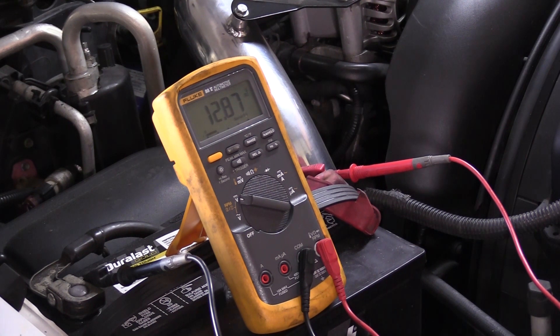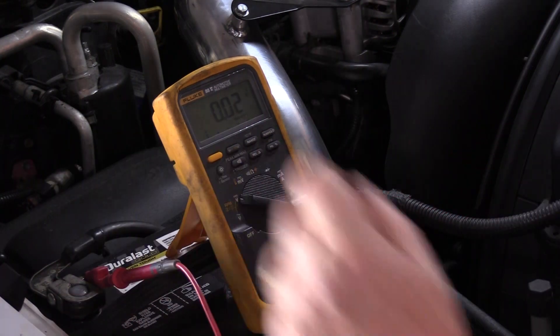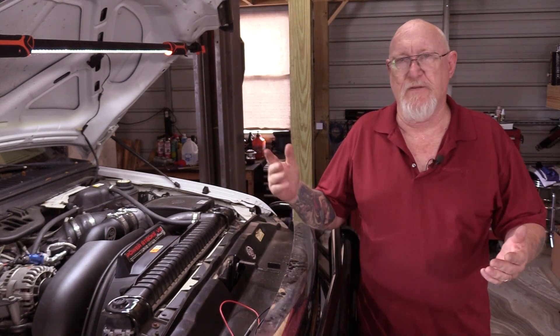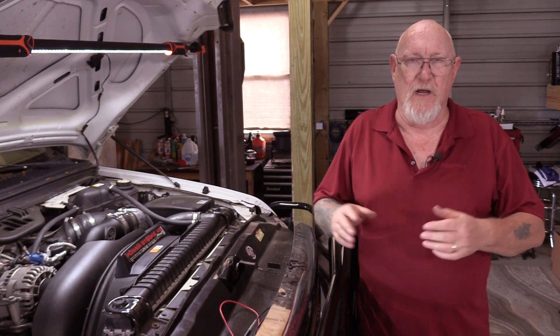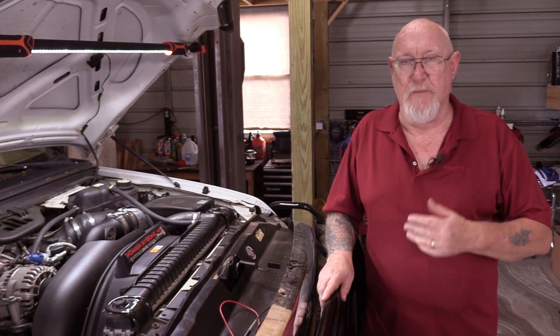When we talk about electrical theory, it's often referenced to the positively charged particle — a proton — even though we know it's the other way around. We can show that by reversing the leads: since we're measuring potential between them, it really doesn't matter. You'll see the same number but now with a negative sign. Voltage is not static — it's a measurement of potential energy difference between two points. And when you understand it takes energy to get past the various resistances in a circuit, that helps you find problems. That's what voltage drop means: energy loss across a resistance. Some is normal, some is not, and when it's not, that's what causes problems.